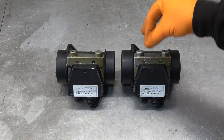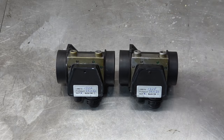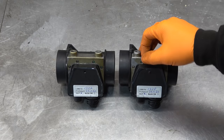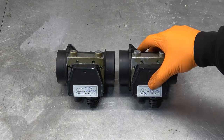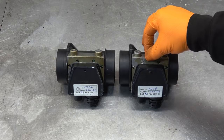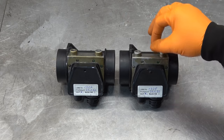Thankfully nowadays you can actually service and repair these. Extra Classics is offering that service — they tested both of these and one was out of spec, so they did some work to bring it within spec. You can see the results and it says 'good', so we're safe to install it. They also tested the MAF cleaning product on these particular MAFs and it makes zero difference if the MAF is out of spec and not working properly. I've seen too many times people throw these away and install cheap aftermarket ones — don't do that. Just have these serviced. It's not that expensive — around 100 euros — and you'll have a perfectly running engine.